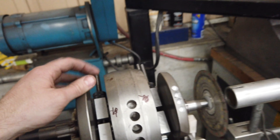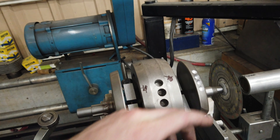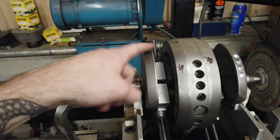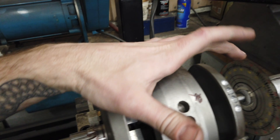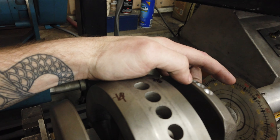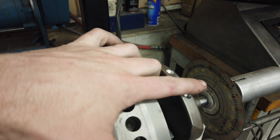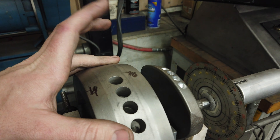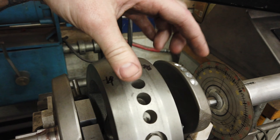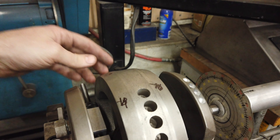We got a change: we were at 40 and now need to remove 16. Not too bad. On the left side it changed to angle 40 and wants us to remove 8, so I might go ahead and make a correction there and continue a little more over here. At angle 54 it would be about into this area - pretty close to where we started at 52. It's moved over a little bit. I may go a little deeper there or jump over here. I try not to do left and right corrections but because it's 54 and 40 I could maybe go down the center and affect the whole area.